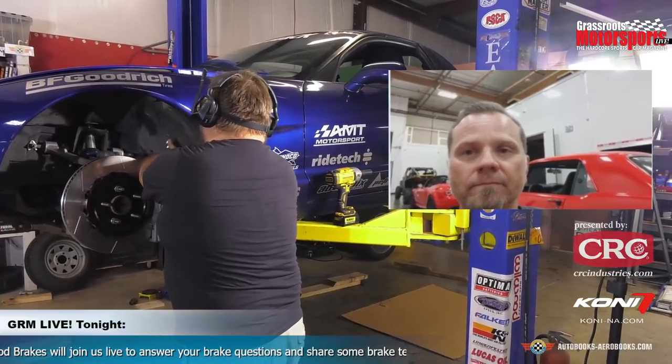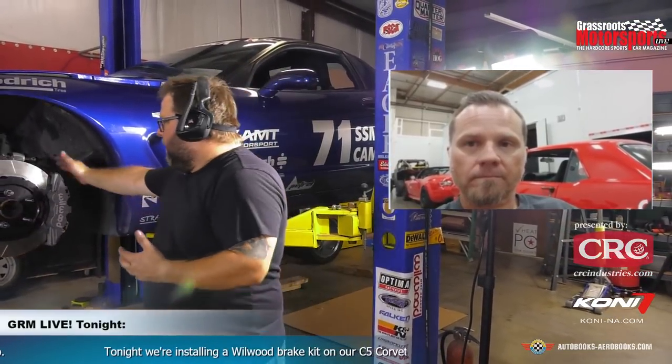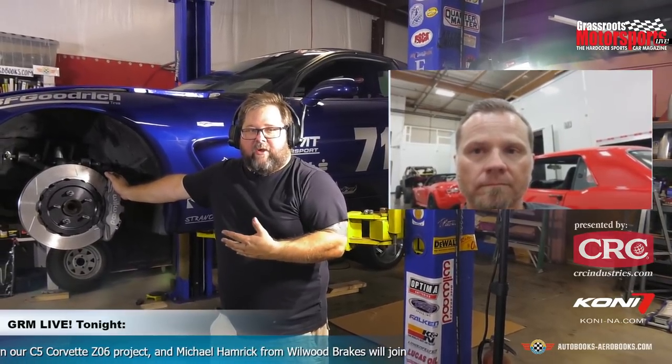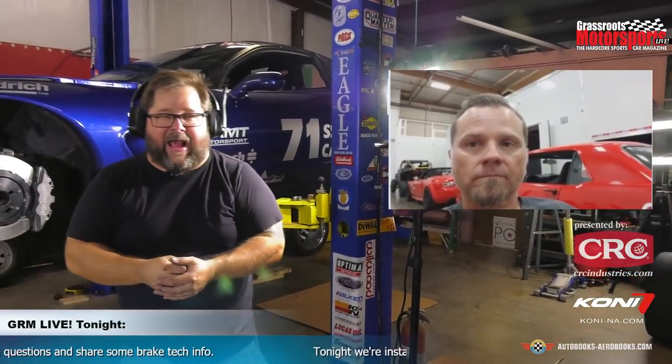Yeah, and I think it's important to mention, we keep coming back to temperatures and stresses here, especially when you're dealing with brake stuff on a heavy car. Even on a mildly driven track car, you're probably talking about 700-800 or even more degrees of temperature in these front rotors at times, and you're talking about tolerances changing, physical dimensions of things changing. Trust the people that actually did the math to figure out how tight that stuff was supposed to be and how it was supposed to seal together.